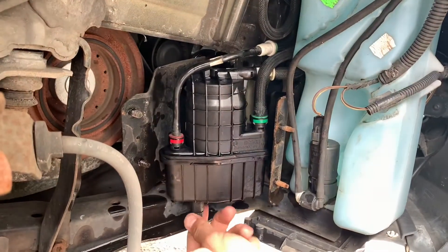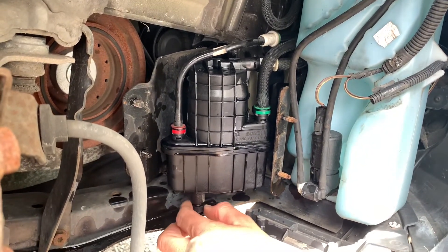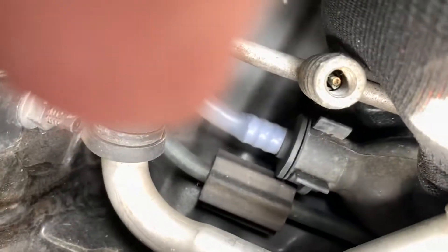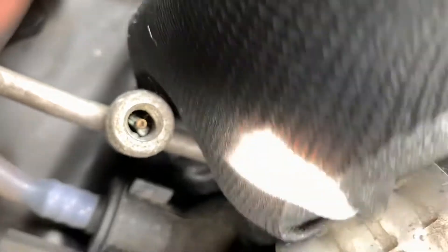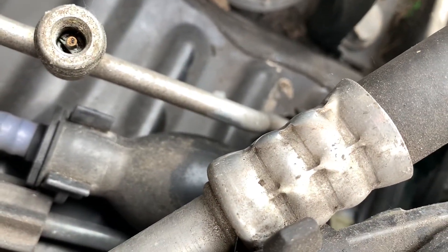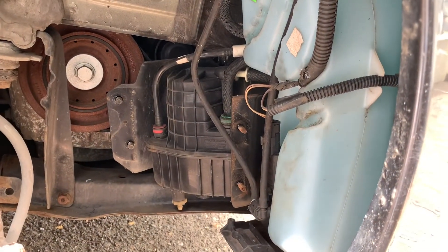That's all sorted. You can bleed it a bit from here if you want, but it'll drip fuel out. After you've done this, you need to come up here - you've got this priming thing here. You just press it on that and prime the system. Put the ignition on, do it two or three times - ignition on and off - and then you can start the engine. It'll be okay. If you like this video, make sure you subscribe to my YouTube channel.